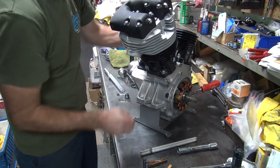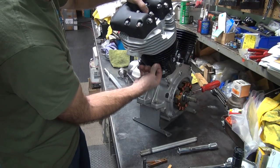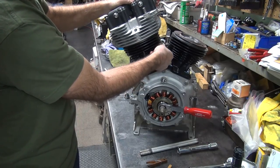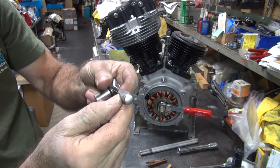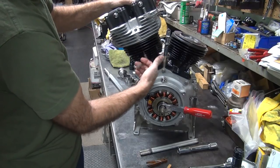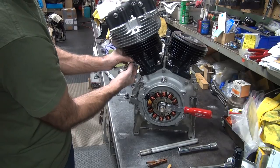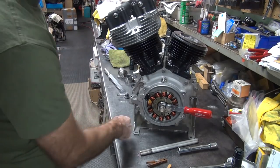Turn this around so I can get to the other holes over here. I've taken my quarter-drive ratchet — I've shaved this down so it fits better. I've also buffed this here so it's not sharp, so if you're banging stuff it doesn't hurt it. That gives me a nice little speed wrench to put these up in there. For now I don't want to get them all the way in — I just want to get them all started a few turns, just enough to know they're all up on there.